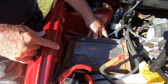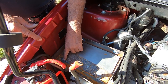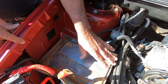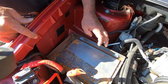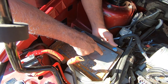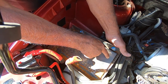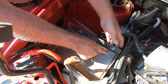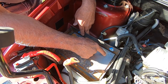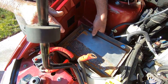I can't completely show you because there's a piece of metal that I've glued with JB Weld and it's covering the way this is anchored. I basically made an angle iron box square. It's attached above the motor mount right about here — there's a motor mount underneath with a stud sticking up. I took advantage of that stud to help anchor this, and then it's also bolted over here. You've got to get creative.